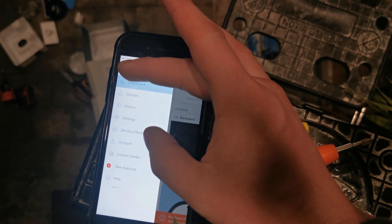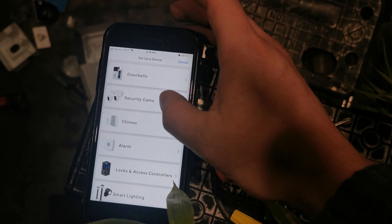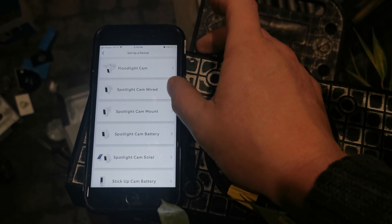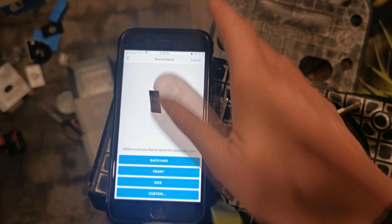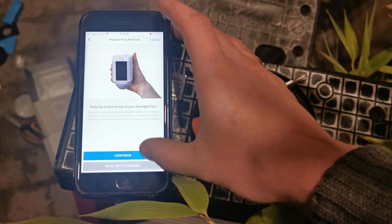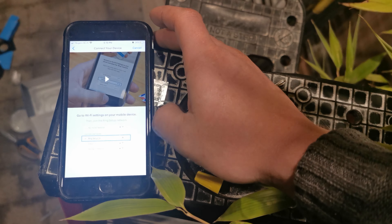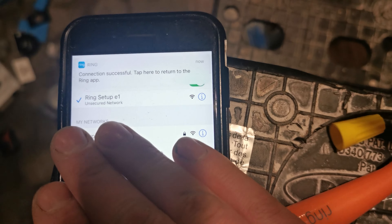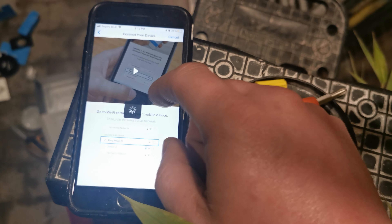Once you've downloaded the app, after you've created a location hit 'Setup a Device.' Then you can say what you want to do — we're going to say 'Security Camera.' We'll say 'QR code' — actually we'll say 'Set up without it,' we're just going to do a wired setup. After you choose the location where you're installing it — your house — select it. I'm going to say the front yard, continue, continue. Then don't hit 'Home' — go to your settings and add it to the Ring network. You'll see it once it pops up on Ring — see 'Ring-dash-something' in your Wi-Fi settings. After you do that, click it, go back to the app, and it'll get you to put in your Wi-Fi name and password.